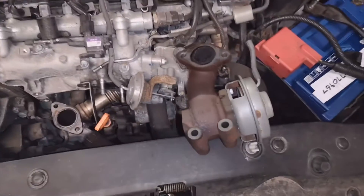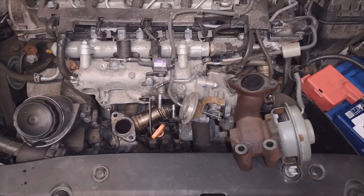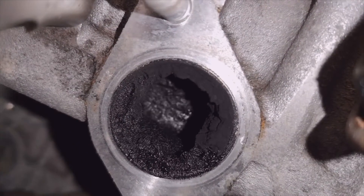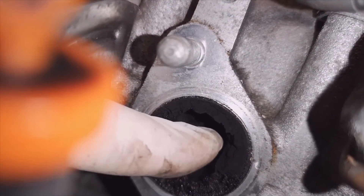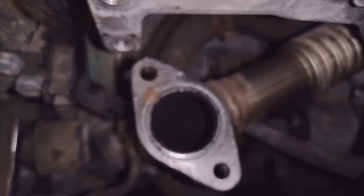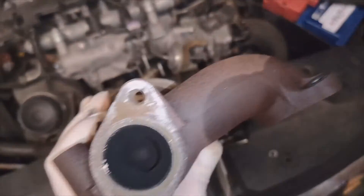Get this clean and that clean. When you're cleaning this bit, don't let anything fall in — you'll probably want to use a hoover to suck up any bits. That's how you take it apart. The gaskets like I said I'll put a link in the description. To put it back together just reverse the video. Also make sure you clean that bit where the other section of the EGR connected. Use your finger to pull all the gunk out — it's horrible stuff, so yeah, clean that, definitely clean that.